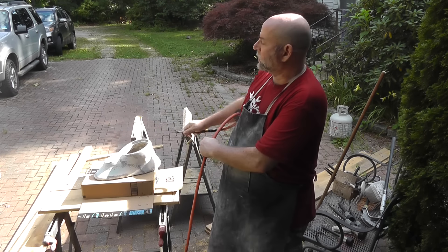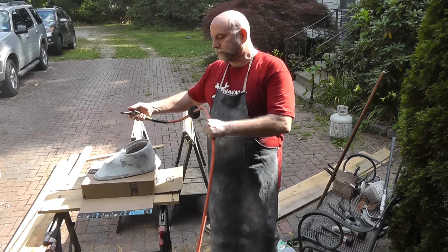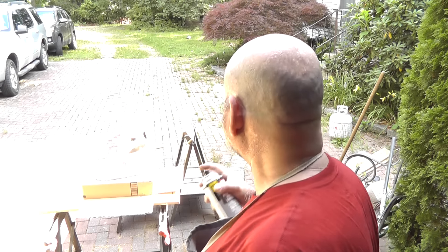I'm going to briefly smooth off the metal glaze you just saw me put on. You saw me using the very front of the orbital sander as much as possible — I didn't have to worry about gouging due to the nature of the sander. Let me show you the next thing we do: as I get closer to the final product, I start getting cleaner. I'm going to give it a good dusting with air, and normally I might even vacuum the inside out, but we're skipping steps.